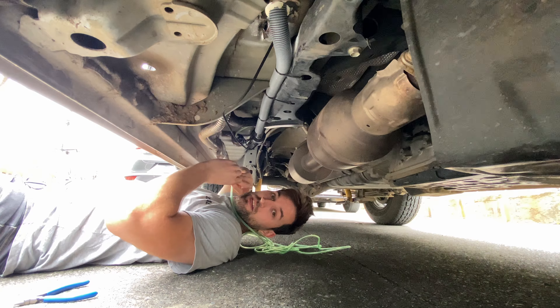See these two lines here — one of them goes to the engine and one goes to the tank. From what I could find online, it comes all the way to the back here. I thought it was maybe for a factory diesel heater, but it's more likely for cooling apparently. I've basically made this little adapter — I've got that capped off in case it had pressure in it — but I've put a filter in, that's my line to the diesel heater, and I'm just going to put it all together. Hopefully I just connect that to that and it'll work.